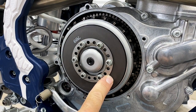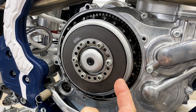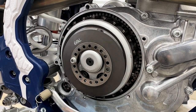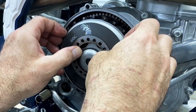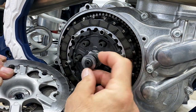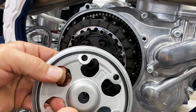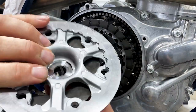First we're going to remove these six 5mm bolts — these are the pressure plate screws. Then the pressure plate ring, which is a Belleville spring, there's a slider ring just behind it that you can't see, and then the pressure plate. We're going to grab the whole bunch all at once. Watch out for the push rod here which has got a bearing on it. So we have the Belleville spring, pressure plate, there's a little wear piece right here — you want to keep that together.